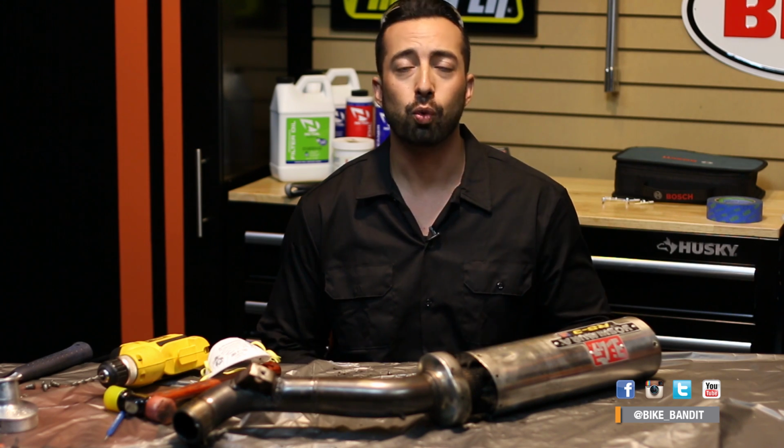Now you can pull out the tube and the packing, but before you do this, get ready to deal with the nastiness of fiberglass. Fiberglass particles will get everywhere when you do this, and fiberglass is no joke, so protect yourself. We're going to use work gloves and a dust mask while doing this, and wearing long sleeves is a good idea too. In addition, cover your work area with a big trash bag so you can crumple it up and throw away the whole thing rather than trying to sweep up fiberglass particles afterwards.